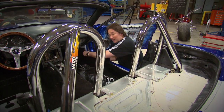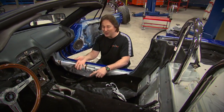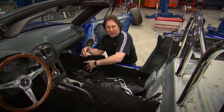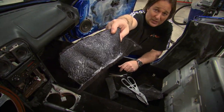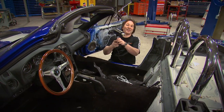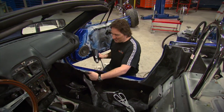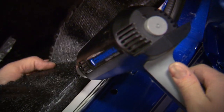The one thing that invariably happens when you're working with a form-fitted carpet is you're going to find that there are some creases and bends that don't really match what you're doing. Some people will tell you to just mash that in and glue it down, but that's not the way to do it. You've got to reform the carpet, and the way to do that is with a heat gun. Now this is not a hair dryer — this is a heat gun, and it goes up to a thousand degrees. All you have to do is just melt the plastic and reform the carpet.